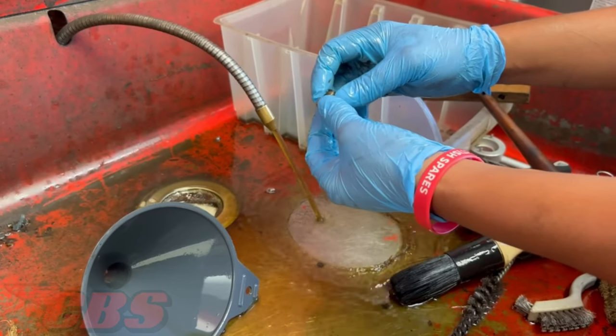Now that we got the oil change done, just a little tip I do here at the shop — good habit. Log everything. So on this particular bike I have some information here: my last oil change was on August 17th, which tells you how little I ride this particular bike, and you can see some of my history as far as what I've done to the bike. It's really a good habit to get into — writing everything down. We're going to write down today's date, the type of oil, and the mileage so that when we do our next oil change interval, we'll know we have to be somewhere in that range — whether you do the 500 mile, 1,000 mile, or if you want to follow the manual which says 4,000 miles. This is going to wrap up today's video. I appreciate you guys watching — don't forget to like, share, and subscribe to our YouTube channel. Thanks so much, have a great weekend, and we appreciate your support.